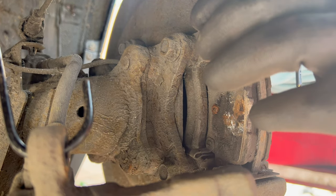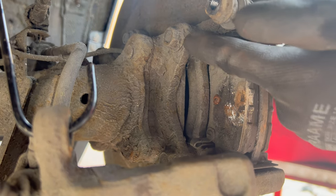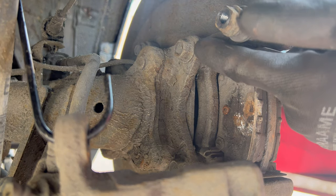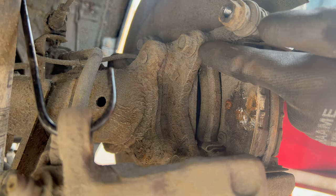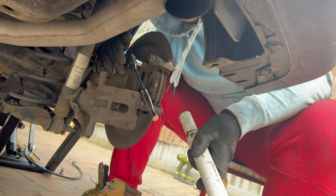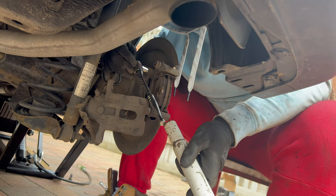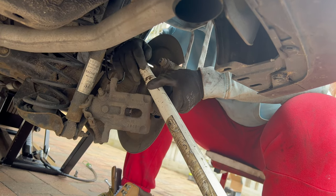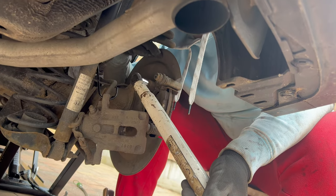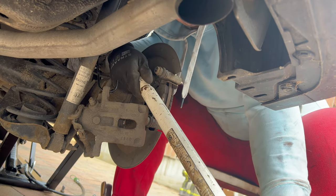There are another two bolts — top and bottom — which hold the brake caliper bracket to the wheel hub. To remove these two bolts you will need a size 14 hex socket. You can also use a penetrating fluid so it's easier to loosen them. You can undo these with the same method: put the ratchet on with the socket, use the jack handle as leverage. Alternatively, use a swivel-head ratchet outside the wheel arch — I'll use the leverage method since I have the car high enough.